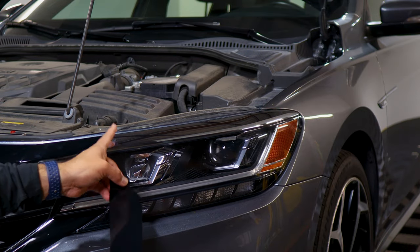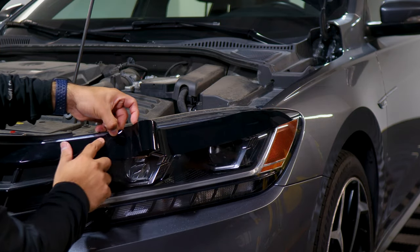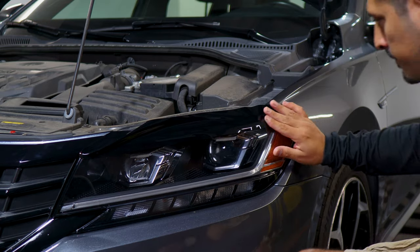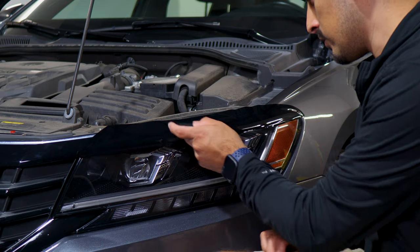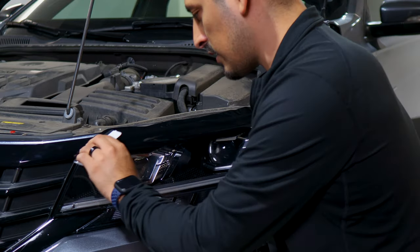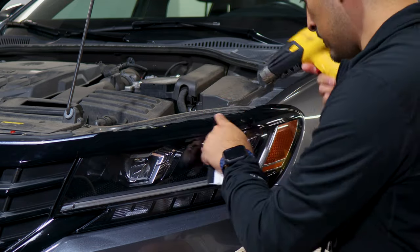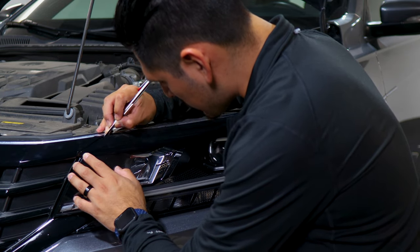Once you're finished installing that piece, we can move on to this next section. All you need to do is place the film and align it right on the edge — give yourself a little extra material to work with for coverage on the edge. Carefully lift the film and make sure you align it to the panel, following the design to reach the other end. If you need to lift and readjust, you can — take it easy and follow the design. Carefully start tacking down the film, removing any air bubbles. Apply heat to help the film tack down, then trim off any excess material you don't need.